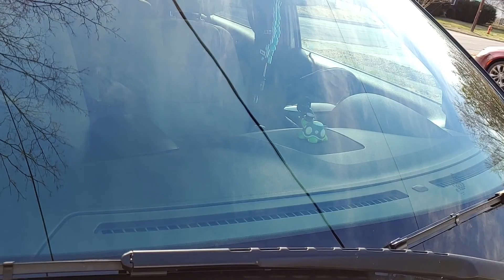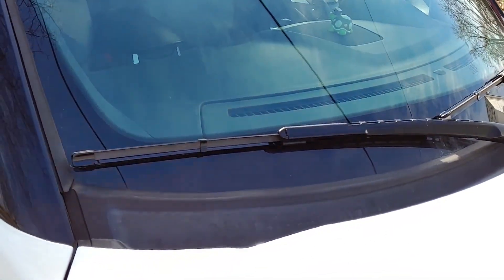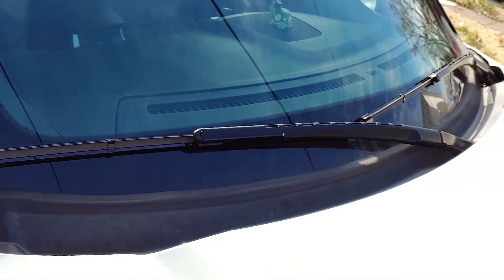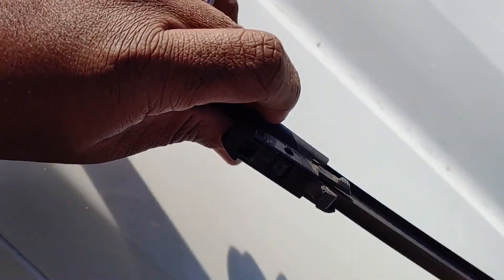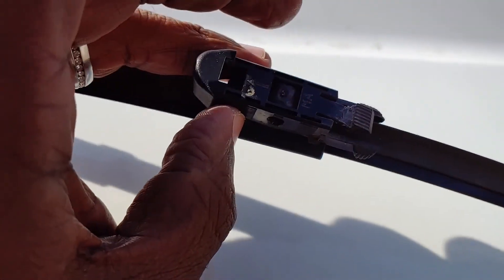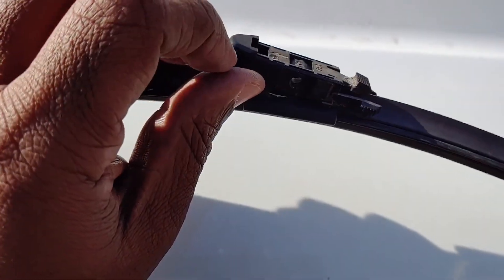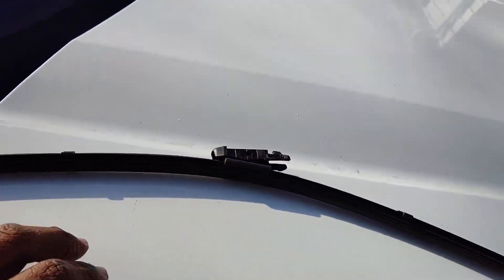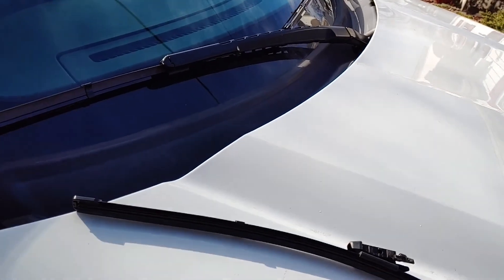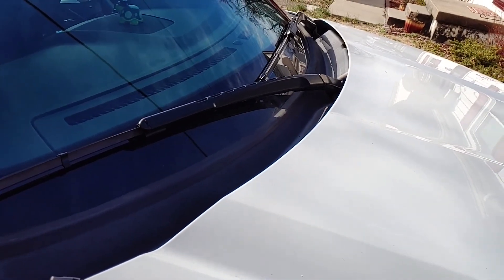Set it down and there you go — that is how you install the windshield wipers on a 2015 Ford Explorer. In the description area I will put what years this will all go for, because different wiper arms need different types of wipers. This wiper type has two little tabs on the edge and a main tab you insert into the top, then push in. Please hit that like button, share this video, and if you're new to my channel please subscribe. Stay safe, peace.